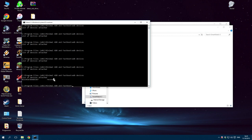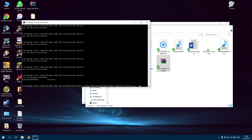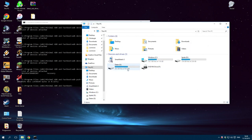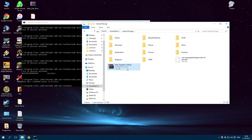Back at the PC, enter adb devices and verify that your device is connected. Then enter adb push and select the SuperSU.zip file, press Space, then enter /sdcard — this will put the zip file inside the virtual SD card on the device. You can also open This PC, select SmartWatch 3, then internal storage, and drag and drop the SuperSU.zip file to the internal storage. This will also work.